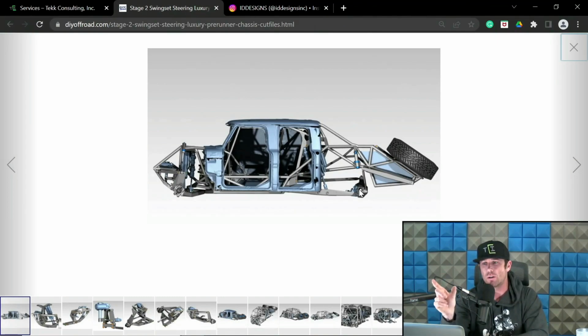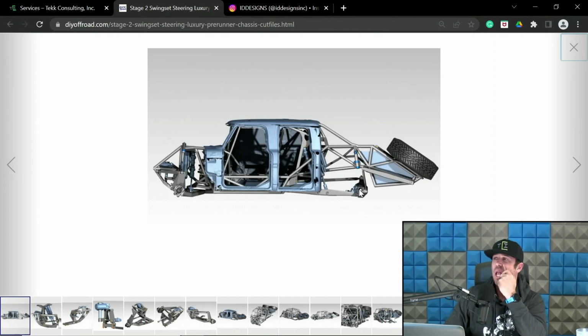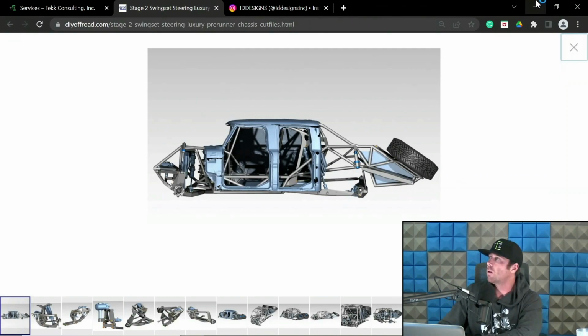I like the wheel well to look centered at ride height, and then when it's at compression, it'll be a little bit towards the front of the wheel well. But I feel like that's better than having the wheel well off at ride height but centered at compression. Again, it annoys me when it's not centered at ride height. But you know, different strokes for different folks. So that's wheelbase. Now let's go into camber.